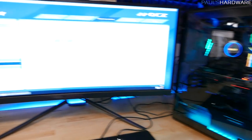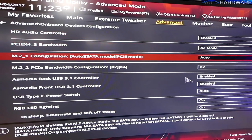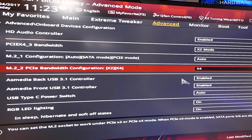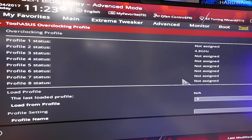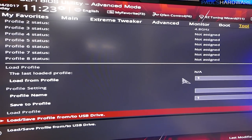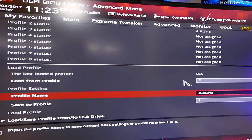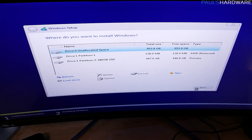I'm going to get Windows installing back onto the OCZ RD400. Also, since I noticed the SSD wasn't in the right configuration, I found the M.2 PCIe bandwidth setting in the BIOS and bumped it from x2 to x4. I'm saving this in the overclocking profile — whoever gets this can easily punch in the 4.8 GHz CPU overclock, and might be able to push it beyond that too.